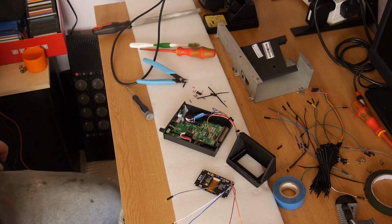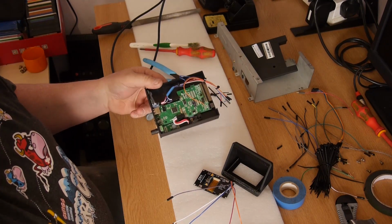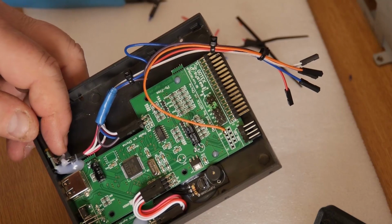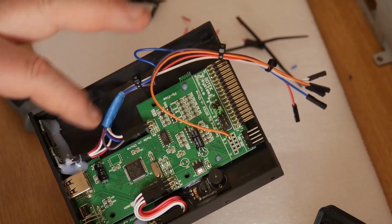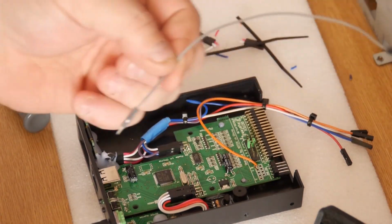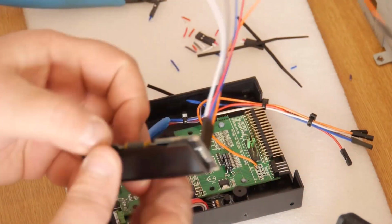Okay, sometime later. Okay, what I've done here, I don't know if you can see that, let's zoom in a little bit, is I've taken the VCC, the ground, the SDA, and the SCL, and I've just basically paralleled them off. So all I've done is extend them out, like so, using small Dupont cables. Lots and lots of them. So if you know what Dupont cables are, just using these. Male females or male males, you can buy them, there'll be a link in the description.